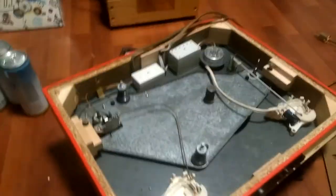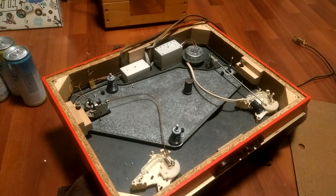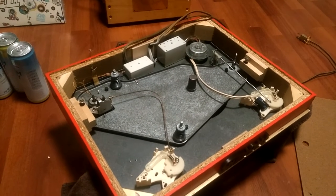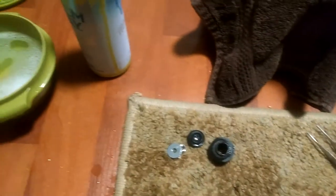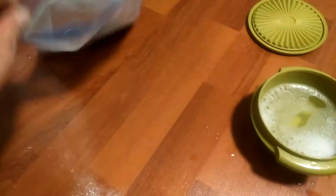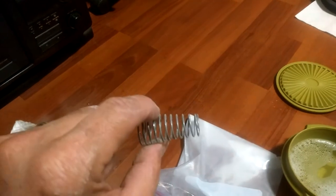This is just to show that I'm doing all of the things that are in Vinyl Nirvana and Thorens sites with regards to cleaning the springs. I've got some soapy warm water and talcum powder. Here I've got a spring set I just pulled out of the water, cleaned with a magic brush, so the spring is nice and clean. Then you put it in the talcum powder to coat the spring, which basically prevents moisture from corroding or oxidizing on the spring.